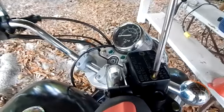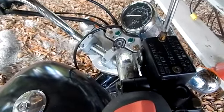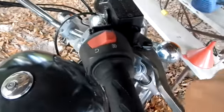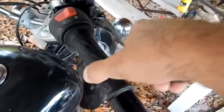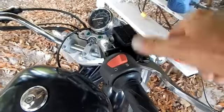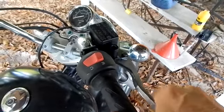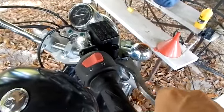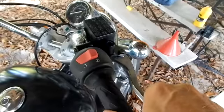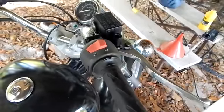Now when I serviced this and bled it, I couldn't video it because I had to hold the motorcycle upright so I could get the fluid all the way to the top. All I did is I poured fluid in it and I slowly depressed the brake handle and looked in the reservoir, and you could see all the bubbles coming up and bleeding out. I didn't remove the lower end of the brake fluid line so I didn't get bubbles way down deep, but bled it all out.